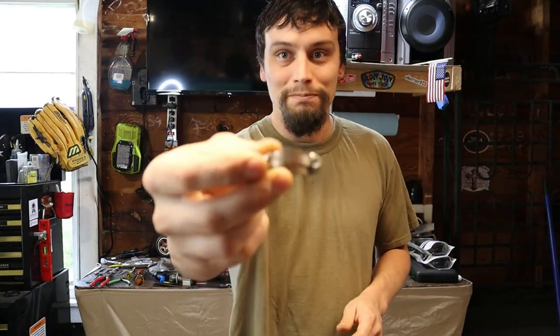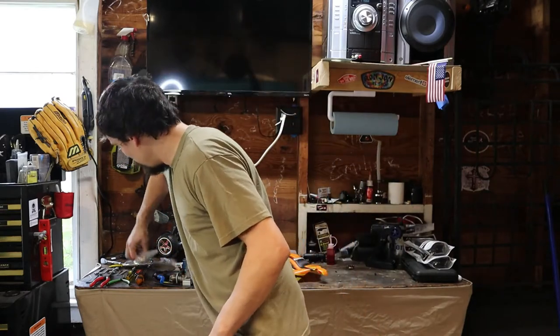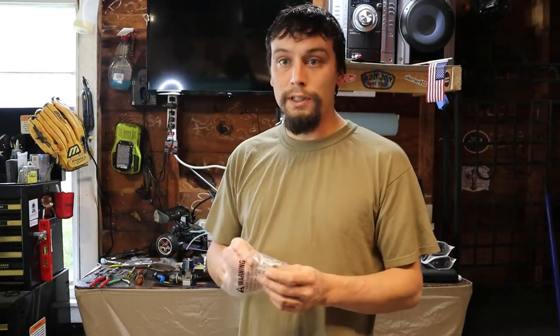Basically I took a normal hose clamp, put a couple of them together and tried re-squeezing it down. The problem with doing that is you don't get a perfect round crimp all the way around. So my piston did get tighter where it's supposed to, but it didn't end up actually sealing — it wasn't a perfect circle. So I did order a new sleeve and piston for it.